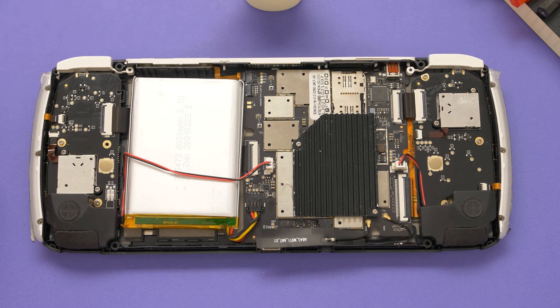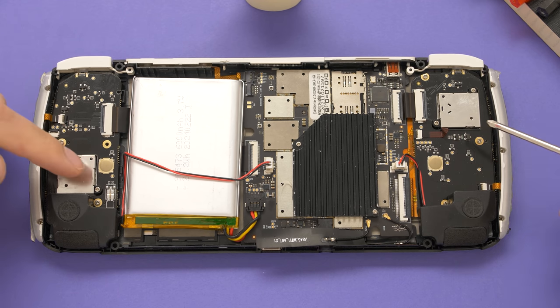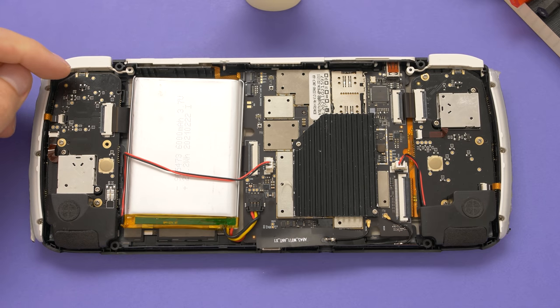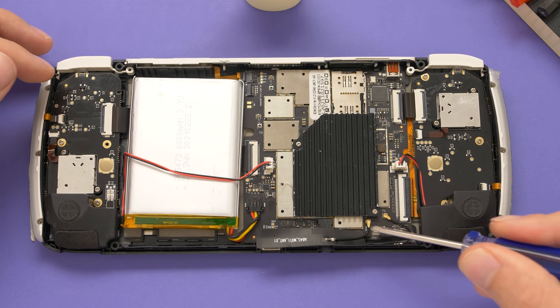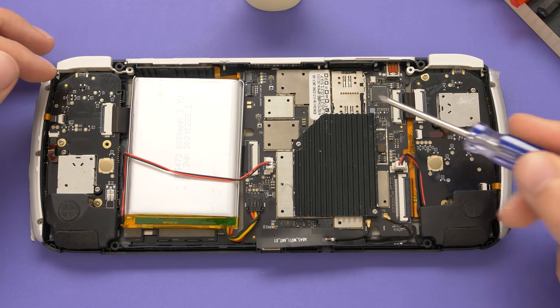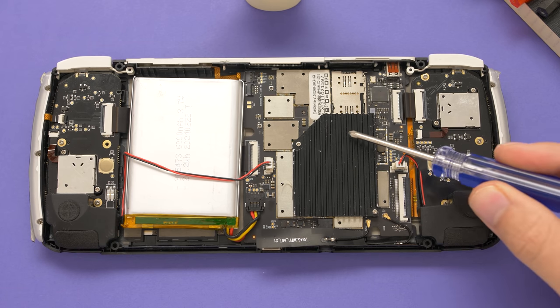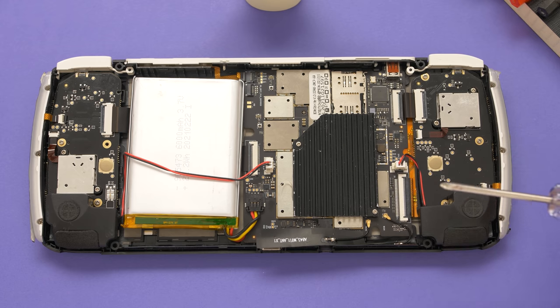Let's zoom in to see what we're working with here. We have the controller PCBs on the left and right side, the analog sticks with ribbon cables that go into the assembly, and our bottom speakers. This is only using a 6000mAh battery, and the routing for the speaker is completely different on retail devices. On the bottom, we have two WiFi antennas but no 4G antenna. There is a very small heatsink that covers a little of the processor and board. This prototype might have a fan — it probably should — but no extensive testing has been done yet to find out if it needs one.